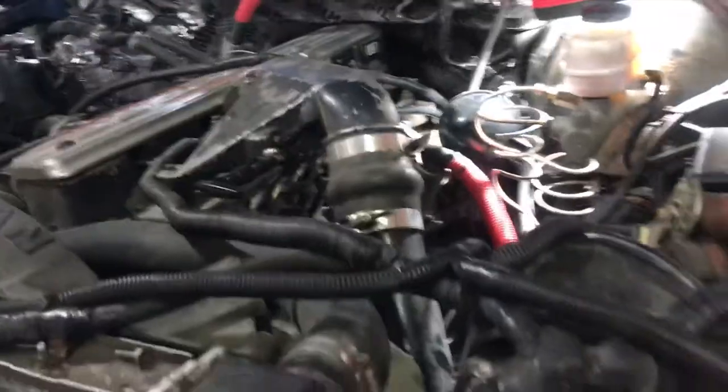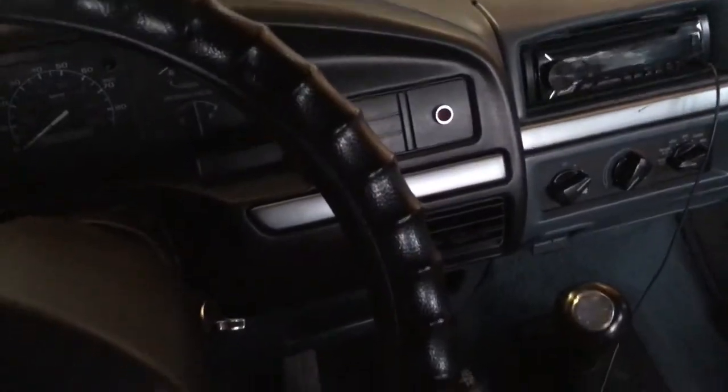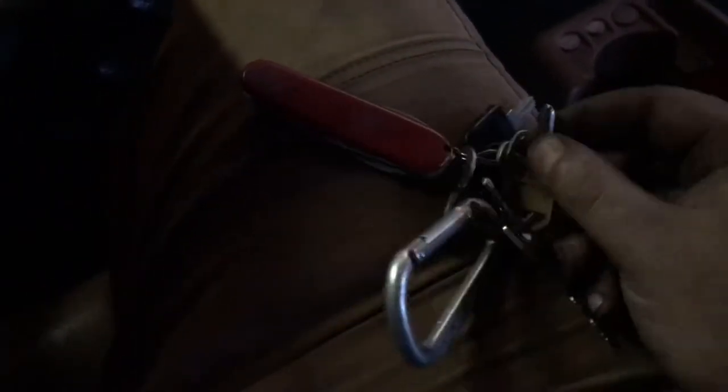The solenoid does get hot — apparently after 45 minutes to an hour of driving that's normal, not a big deal. The big issue was if it pulls up all the way, which it was, so now it's properly adjusted. I also put WD-40 on all the ball and socket joints. I'm thinking about upgrading to heim joints because there's a little slop in them that could cause lag on the accelerator. Alright, give her a whirl — yep, I'm happy.